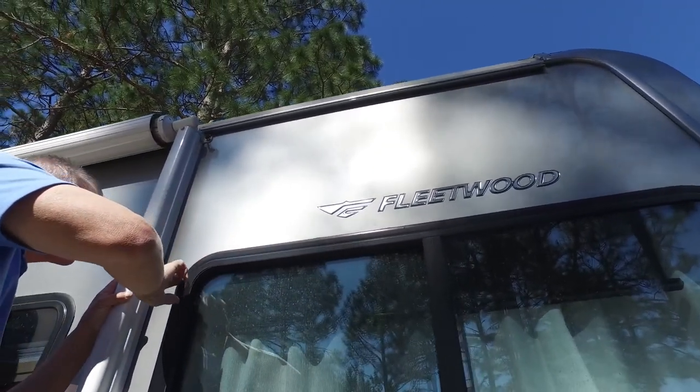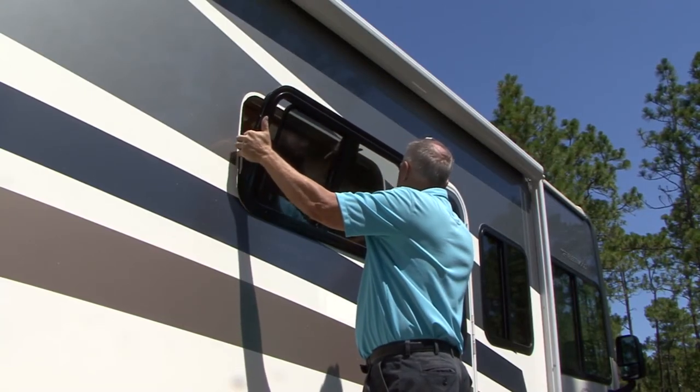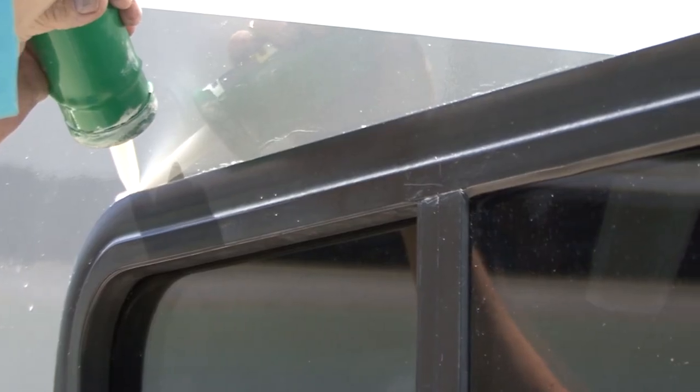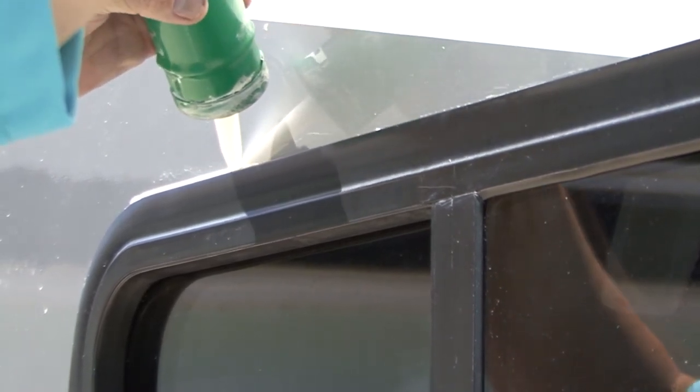When a component is installed in the sidewall of the RV like a window, a bead of sealant is added around the top and the corners to let water run off and prevent leaks. Inspect all of these sealants and add sealant as required. The key is to thoroughly inspect your RV for water damage. Take your time and look closely for anywhere water can potentially find its way past the surface of the RV and take the necessary measures to correct the problem as soon as it's detected.